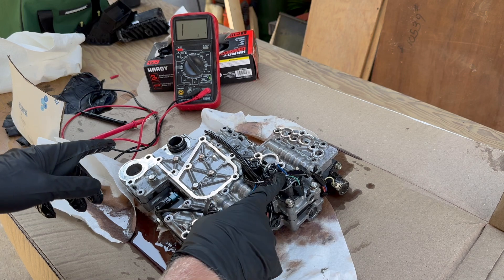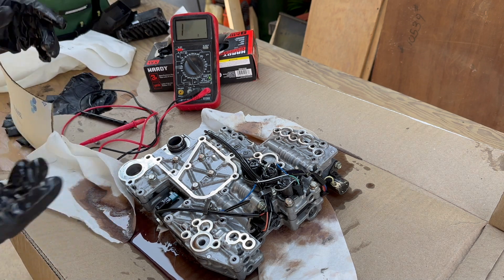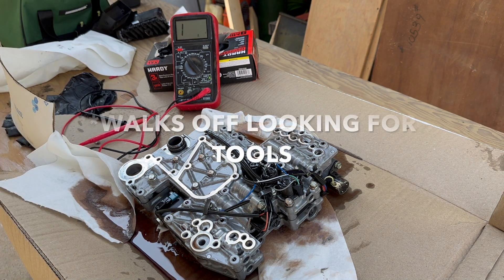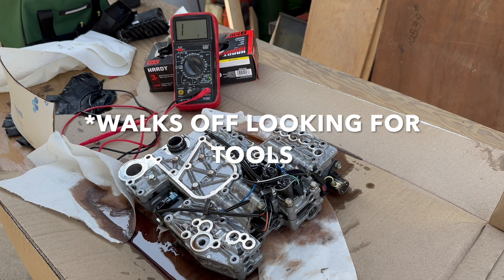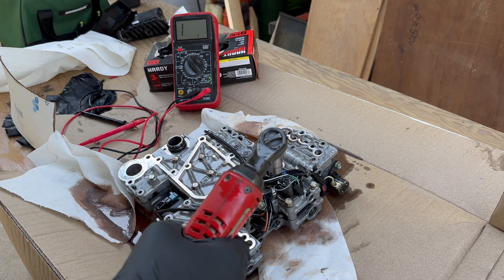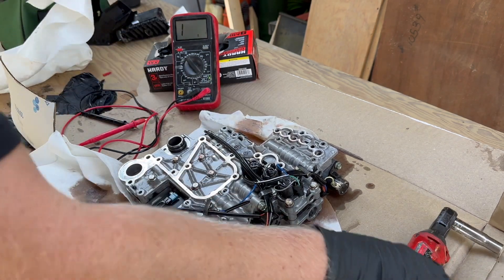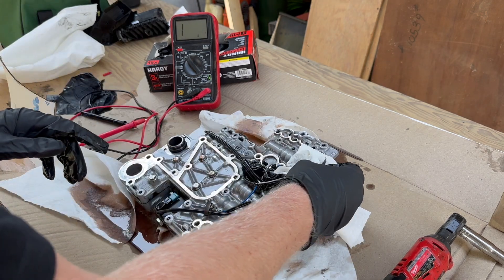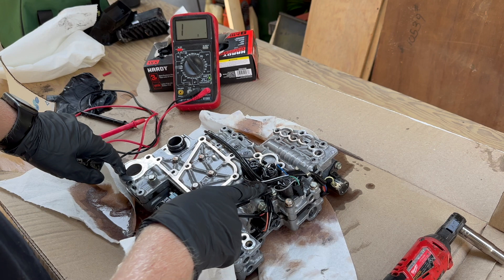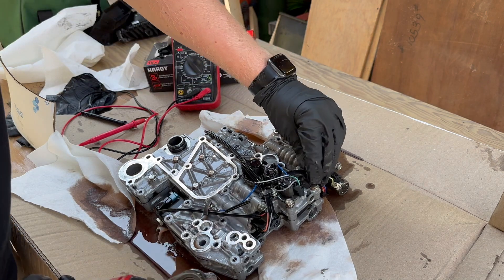I do know this one was bad when I measured it hot — it's this one right here, the torque converter solenoid, the first of the three. We're going to start off by getting out the handy dandy battery ratchet. There are some 10mm bolts and some covers going over the top of these wires — for example here, here, and there's one back here on this bolt.